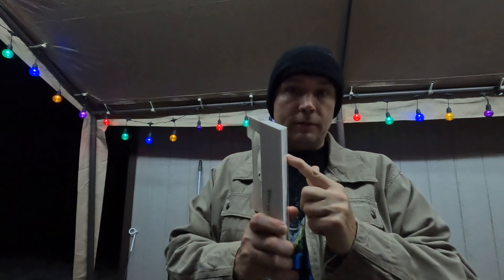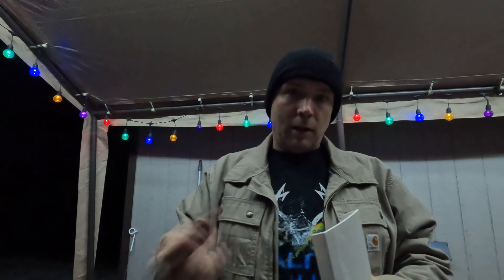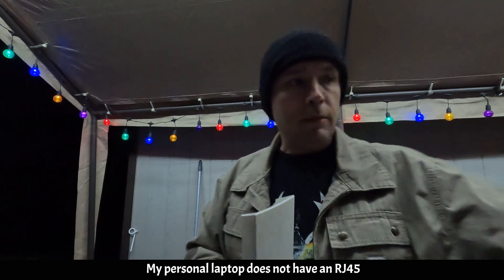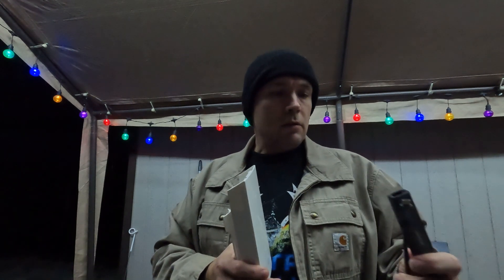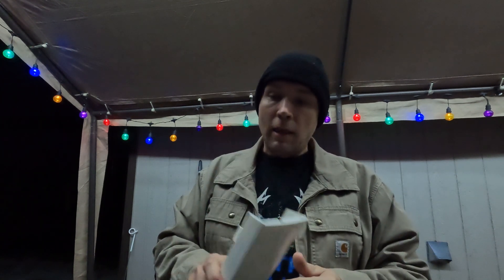I did not show the software setup of these two things, mainly because I don't have a good way to record the computer screen, and I didn't want to have to worry about masking out my passwords. So I'll just tell you what I went through. Two units, both refurbs. First one: plug the wall into the PoE adapter, plug the PoE adapter into the bottom box, then plug my laptop into the LAN side of the PoE adapter. First problem — laptops today don't have ethernet on them. Thankfully I have a USB-to-ethernet dongle. Plugged that into my laptop, recognized it just fine, went into Windows, put an IP address on there. These come default at 192.168.0.254, so I put a 0.1 on my machine, slash 24, and slapped a config on there.